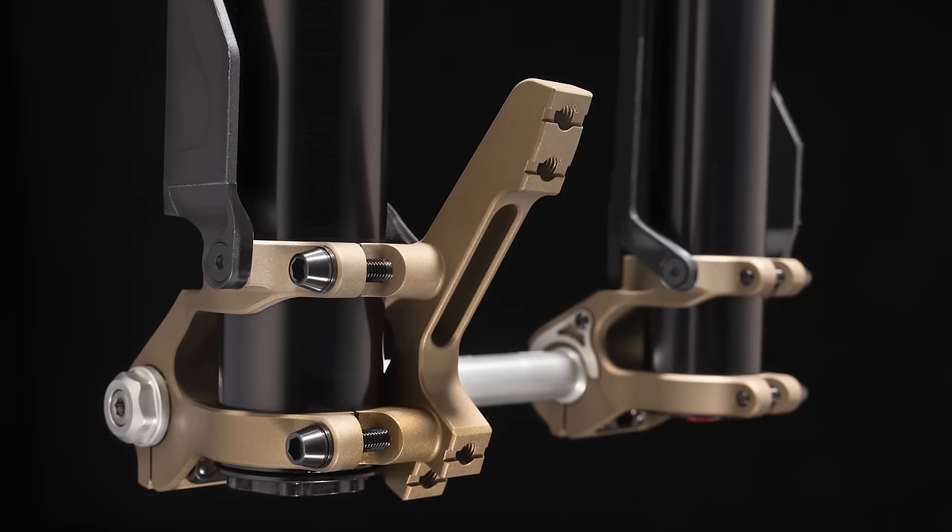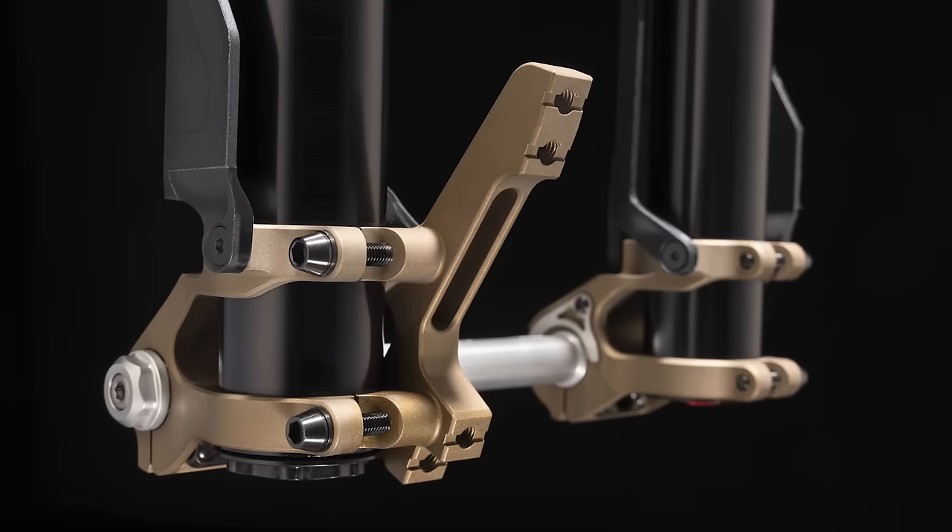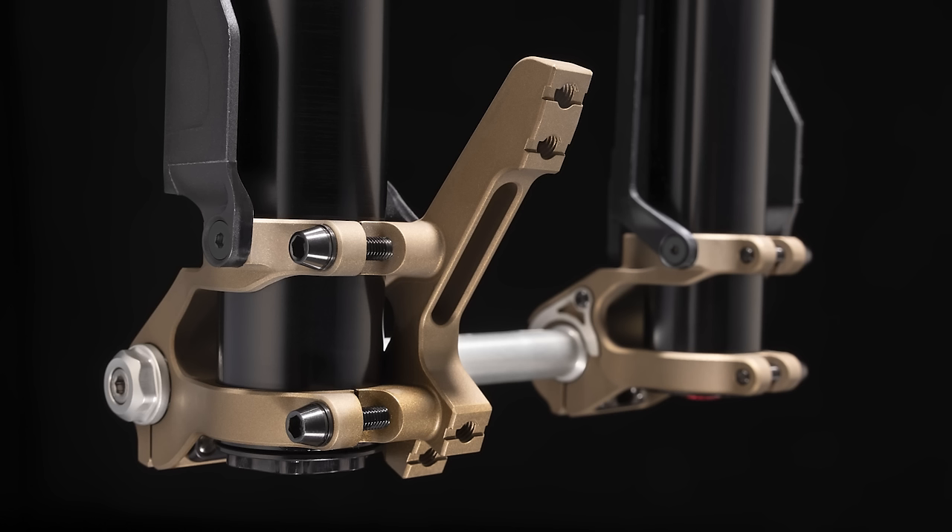Another feature: the brake adapter system. We're constantly changing forks on demo bikes, and it made sense to build a brake system into the axle lug that accommodates both 180mm and 200mm rotors with one mount — no adapter needed. Your caliper just bolts straight up. It's more expensive to do it that way, but it's cleaner. We hear from consumers how frustrating it is: you get your new fork on a Friday, super pumped, and then the brake doesn't bolt up and you need a different adapter. We wanted to solve that real-world frustration.